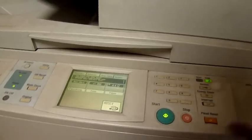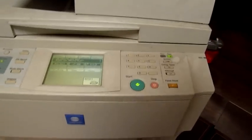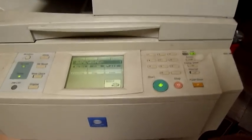That's just a blank shot showing what it's doing — it's leaving toner everywhere. Everything inside the paper conveyor is just covered in it. The unit basically has to be stripped, cleaned, the cause of the problem corrected — like a whole new imaging and toner unit and transfer unit — and then it might be worth using again. The page counter reads 673,000. I have seen these with a lot higher, but I'm guessing those are better kept than this one was.